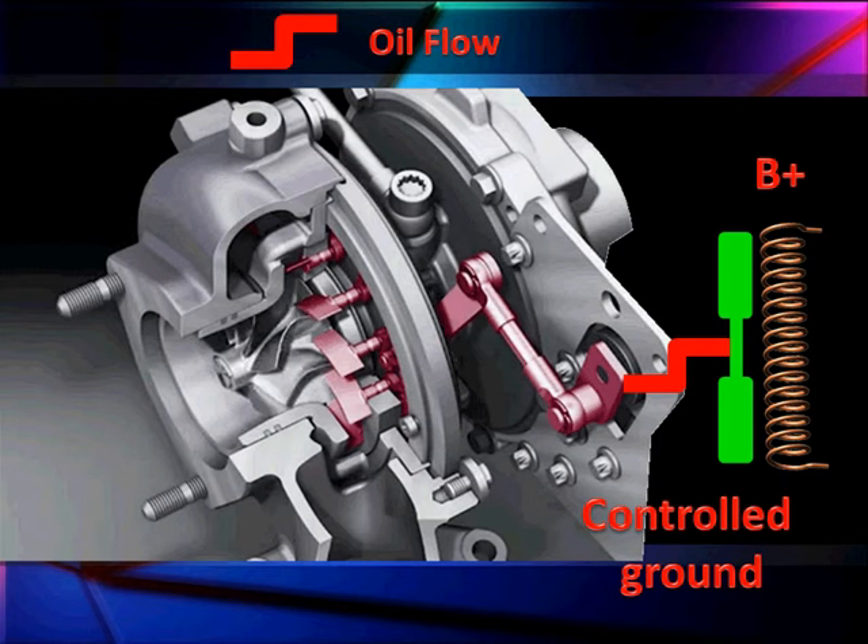Here's what it looks like. We have over here on the right a representation of a control solenoid — that's a spool valve. It's going to be controlling oil pressure, which is shown in red. Right now it is open. We have all the air going in on the left side, getting as much air into the engine as possible — maximum boost.